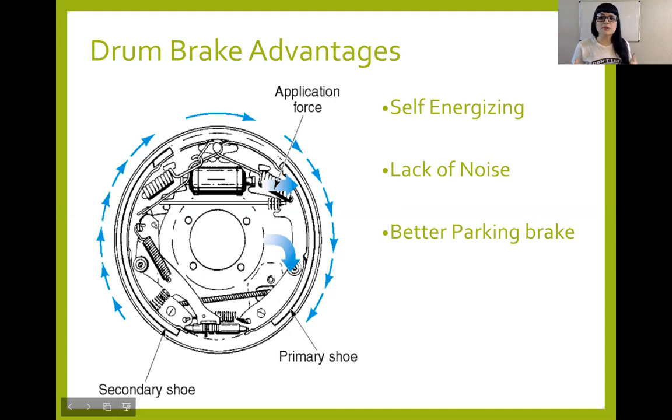I will say, again, because of the design, drum brakes every single time are going to make a much better parking brake, especially with that duo servo design. But even leading trailing make an excellent parking brake. And this has to do with the amount of surface area. And there's two types of friction that we talked about at the beginning of the semester before we had this whole COVID scare. I talked about kinetic friction and static friction.